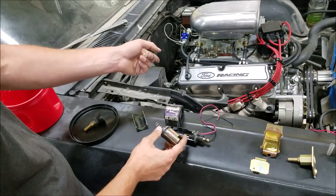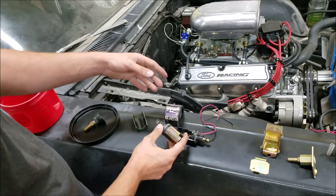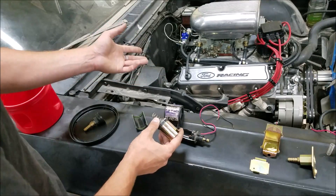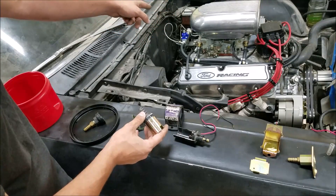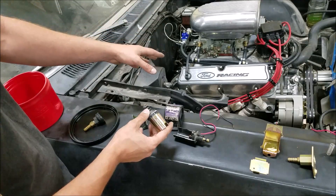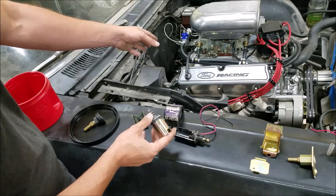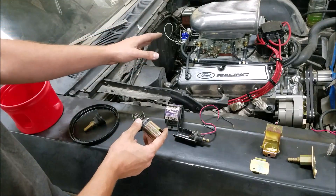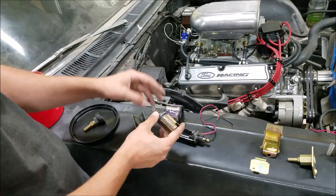On this particular car, my '65 Galaxy, I have a big Holley — or a Summit Black Pump, but it's got a very high gallon per hour to it. I have a full return system, so it's able to bypass a large amount of that fuel and it keeps the pump nice and cool. It really extends pump life and we don't have any anomalies with our air-fuel ratio or vapor locking. It really makes for a nice, consistent carburetor tune. I go over this with my F-100 in another video, which I'll link below.